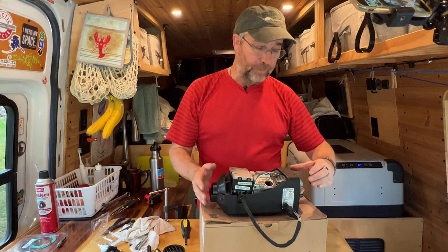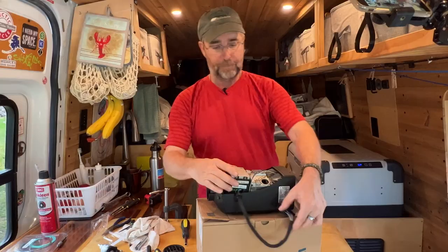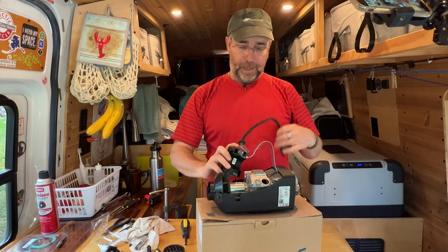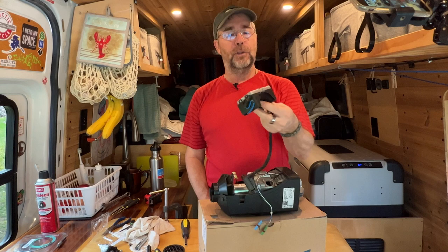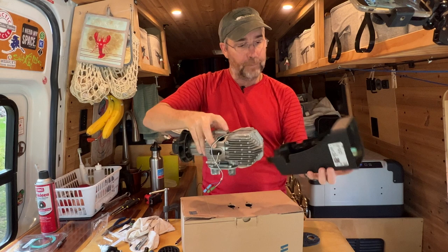Once you've got it out of the van, remember there's going to be a cover on here. Put a flat blade screwdriver into this little slot and give it a twist and that'll pop the cover off. Then you can go ahead and do your atomizer screen, do your igniter, just like I just showed you. You can also take your electronic control module completely off — every one of these plugs will only go back in one direction because they've got little slots on the sides. Once you've got the control module out, take this gasket off the bottom, and then this whole thing will come out of that housing. Now we need a T25 Torx and you remove these four screws around the sides.